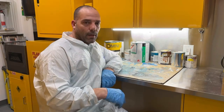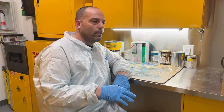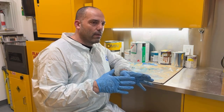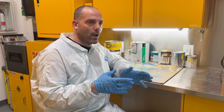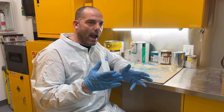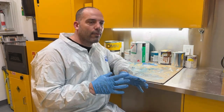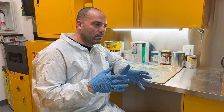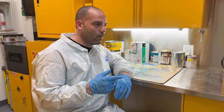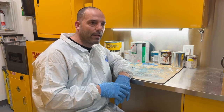Painting a little bit of satin black to get that frame to just be cleaned up and look good. The reason why it's sprayed so nice and everything is it was painted, like I said, a while ago. I'm not sure when. So what I did was I took lacquer thinner and rags and I wiped it all down real good, which took a lot of the paint off back down to the, it's like a weird primer type stuff they had on there. I don't know what exactly it was. So then I just recoated it with a couple coats of that hot rod black paint.